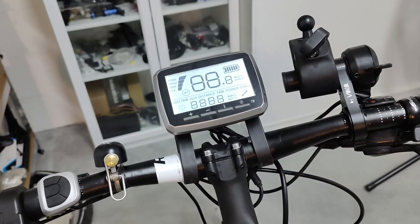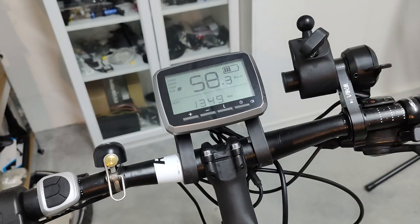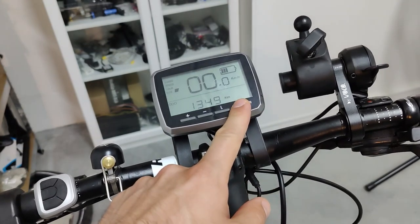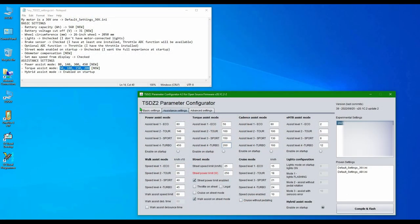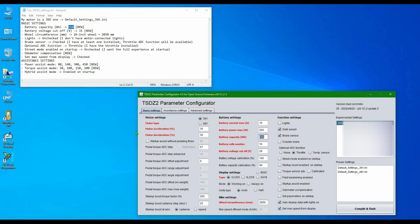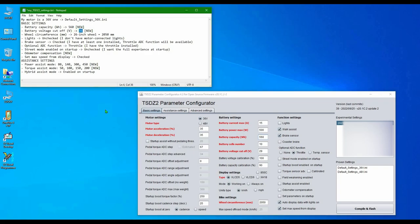Talking about the ghost speed at startup: those are actually useful pieces of information shown by the firmware. The first value is the residual battery percentage. If we turn on the lights, we get more values after that. The second one is the actual battery voltage, while the third one is the consumed watt-hours. Since those values are shown as speed, we should tell the motor to compensate the odometer in order to prevent its increase. For this reason, let's jump back to the basic settings to better match the configuration. I don't expect those to affect performance, but they should help me get even more precise evaluations.